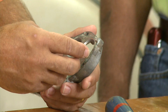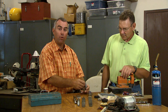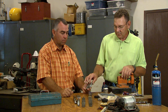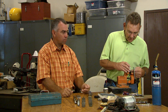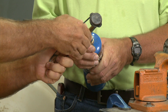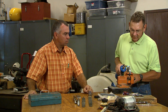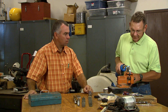Maybe applying a little heat. Oil certainly we can put on there, but if we apply heat and oil it's going to burn right off. So we're going to use some wax — the best thing to use is beeswax. We don't have any beeswax today but we've got some other wax here. We're going to chuck this up in a vise. This is aluminum so we don't want to get it too hot. We're just using a little propane torch here. We're going to heat that up a little bit.